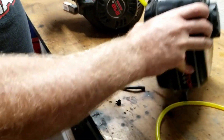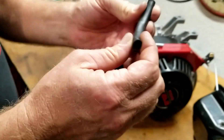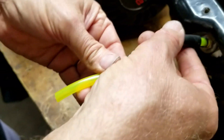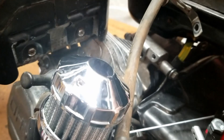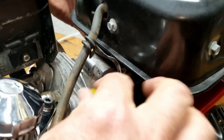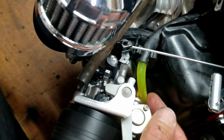I'm going to put the original protective sleeve back on the fuel line because it's going to run right against the motor down in here — there's a space where the fuel line goes. So we feed the sleeve on, put the tank back on, and the fuel line has to feed through. It runs down underneath the throttle cable and rests in that little spot before going right onto the fuel filter. I'm going to shorten it up about an inch to make it fit properly.